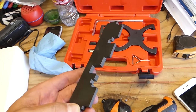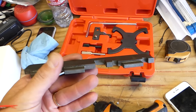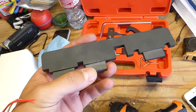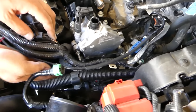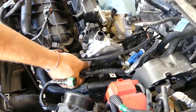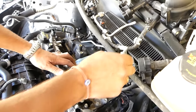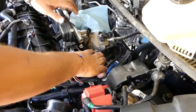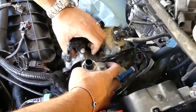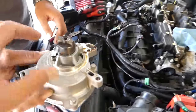Here is the plate we'll be using for the camshafts — in order to install this plate on the back side of the camshafts, all of this disassembly was required. Remove the intake camshaft position sensor — there's one bolt for the valve cover there — and the one on the back side as well. You can label them; check part numbers as they may be interchangeable.